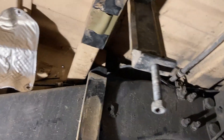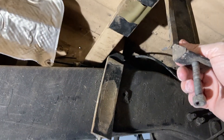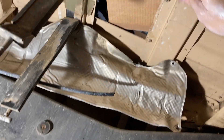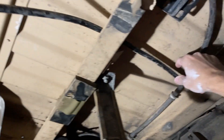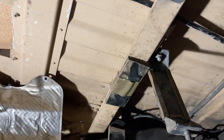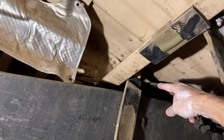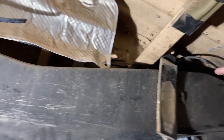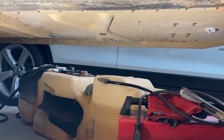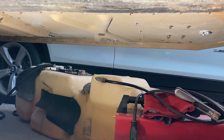The way the fuel tank goes back in is there's a hanger here and here, and the two straps both in the front and the rear hook on here and bolt up here. Tank presses up to the top. This line I think is some kind of air equalizer — it basically allows airflow from the two high spots in the tank, both front and rear. The fuel filler neck comes in from here and there's a vent line going back out there, so definitely don't plug that vent line on the tank — which I started to do with JB weld until I realized what it was for.